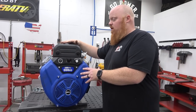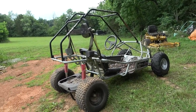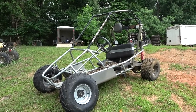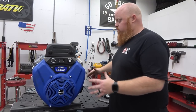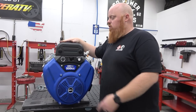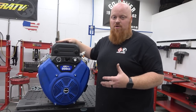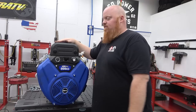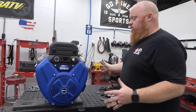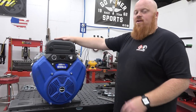For today we're going to build a swing arm to slap this on this Manco kids go-kart. Now this engine does not belong on this go-kart — it has a really crude suspension setup — but it's going to be awesome to put this much power on something that small. First we're going to build out the whole swing arm, get the jackshaft set up for the massive comet pulleys we had to use. DuroMax sent us some comet pulleys made for a massive concrete trowel — that's the only thing that would fit this crankshaft and handle this kind of power. We're going to build the whole swing arm first starting with the jackshaft system, then pull the go-kart in on the next episode and get it all mounted up.